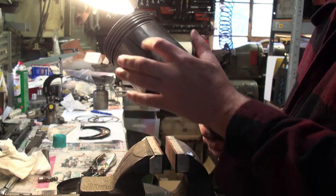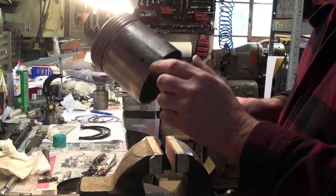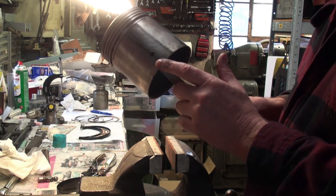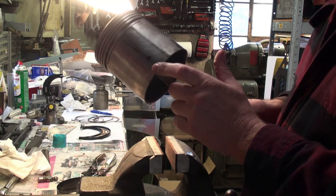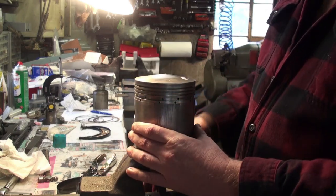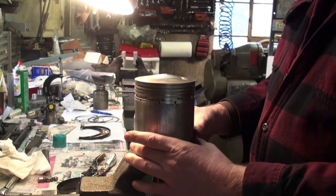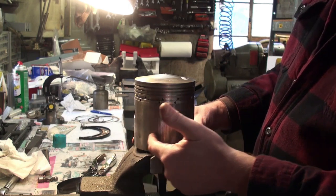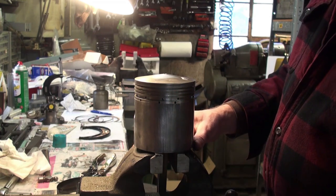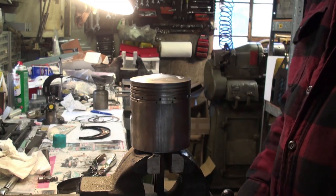So, since we have the T slot and the piston is a bit egg-shaped and tapered, the bottom of the skirt will have a very tight clearance, maybe half a thousandth. I think you can go up to 2/1000ths and still be fine. And that is to control noise. Really the only job of the skirt is to control noise and to keep the piston from rolling in the bore. So you'll see some modern pistons where the skirt is nothing more than a flange coming down there just to stop the roll and keep them quieter. So now if we're looking at an original piston,